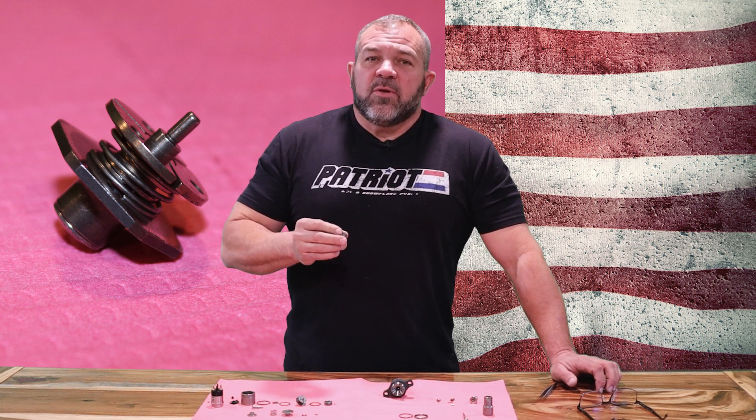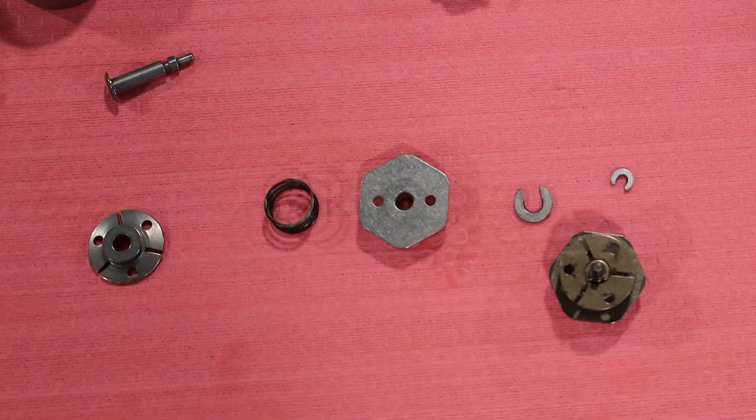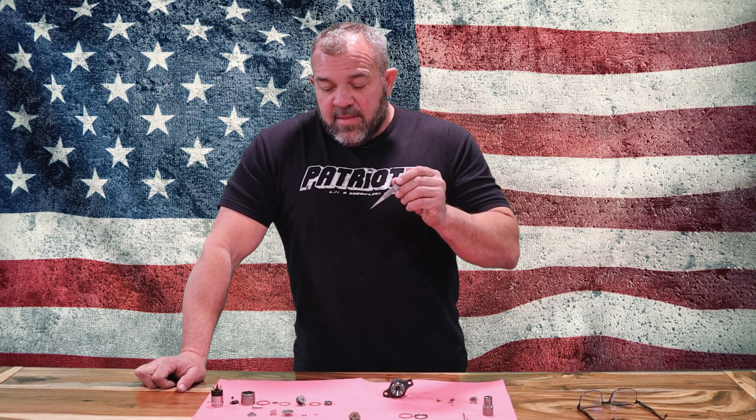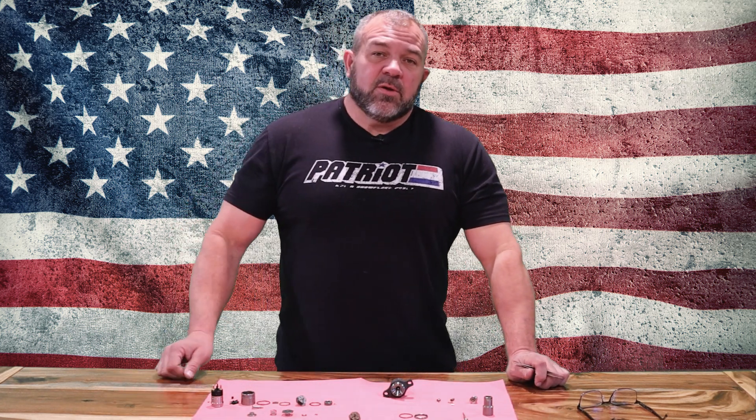That travel is critical and some of these things get really dirty. So what we have to do — just like I have laid out right here on the table — we disassemble the armature assembly. Everything gets tumbled, polished, cleaned, ultrasounded, blown off, and dried out. That job is also quite tedious, but if we're going to give you something that functions correctly, that is absolutely a necessary step.